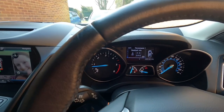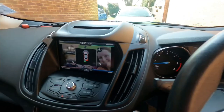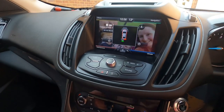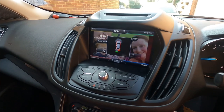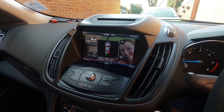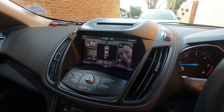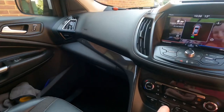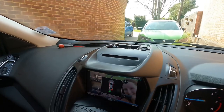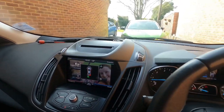Right, nearly all back together. I just started the engine and put it in reverse just to check — rear parking sensors are obviously on but camera not yet active. I've got to plug in FORScan and activate it via that. So I'll grab my laptop and hopefully now I've put everything back together with no mistakes and it'll work. I've left the top grill off just in case.